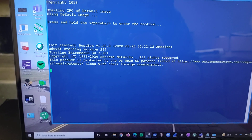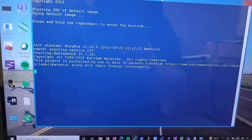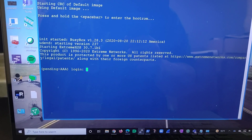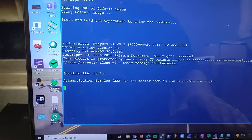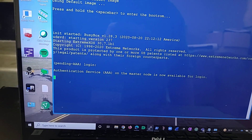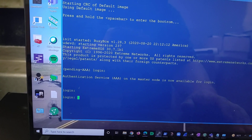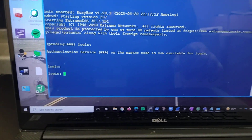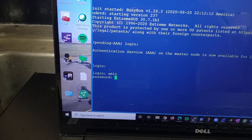After it boots up you'll see lots and lots of informational messages. Luckily these things don't take too incredibly long to boot up. Okay, this is pending AAA, which means there's still one service that's going to start up. That service is now started, so we can try to log in. You'll see it doesn't say anything there, so you usually have to hit the Enter key a couple of times to tell the switch — it'll sense what speed and duplex are being used and that it's got a terminal connected. Just try to type something and try to log in. Yep, it's responding — we got it set up right.